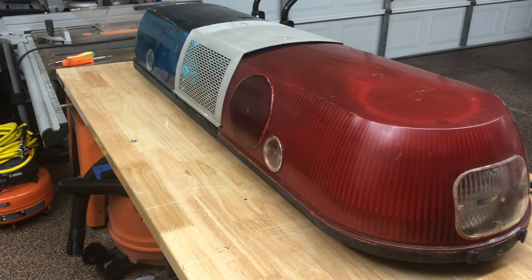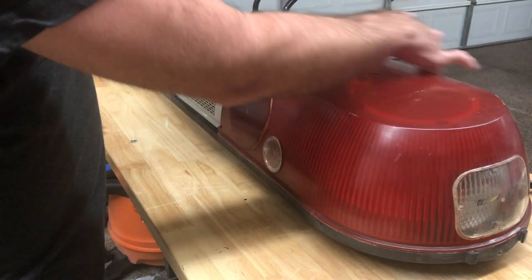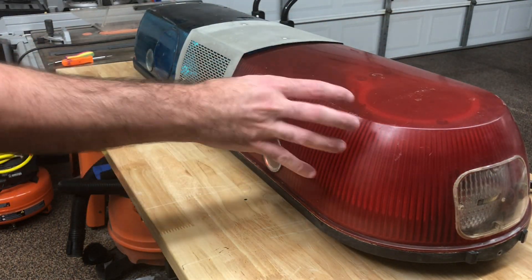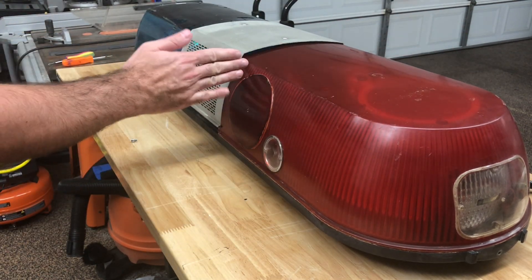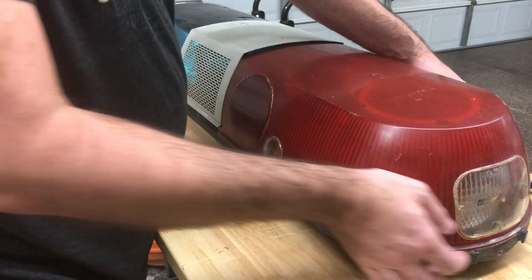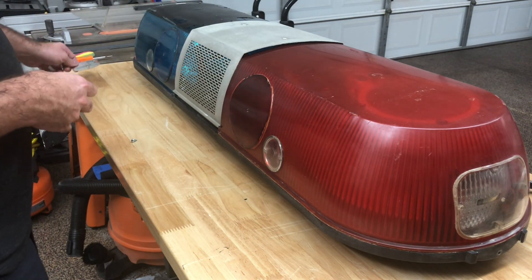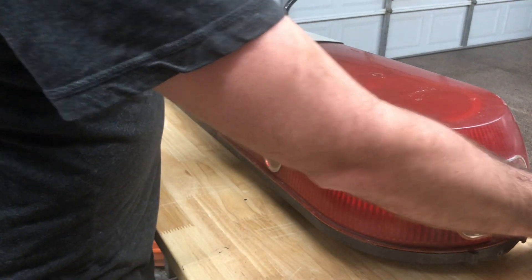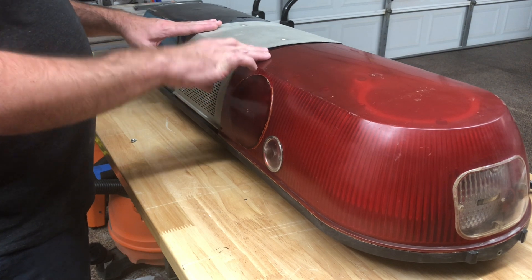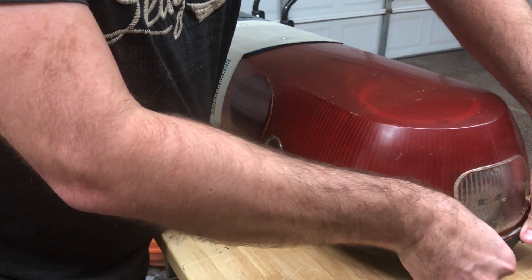And then of course the alley lights on each side. Some things to note about this bar: it is a strobe bar, so you can see the fluting on the inside of this lens, which helps to disperse the light and gives it a slightly wider throw pattern — those are ridges on the inside. This plate usually lives down here but I've already taken it off. This says 'Model 80,' however I was corrected — this is actually a Model 8000 bar. Thanks Richie for pointing that out.